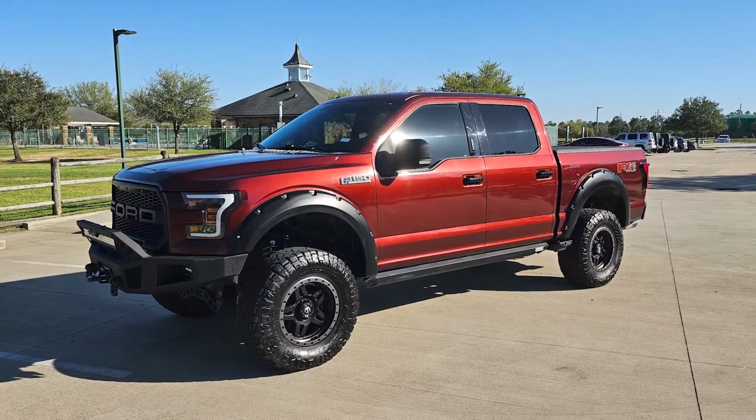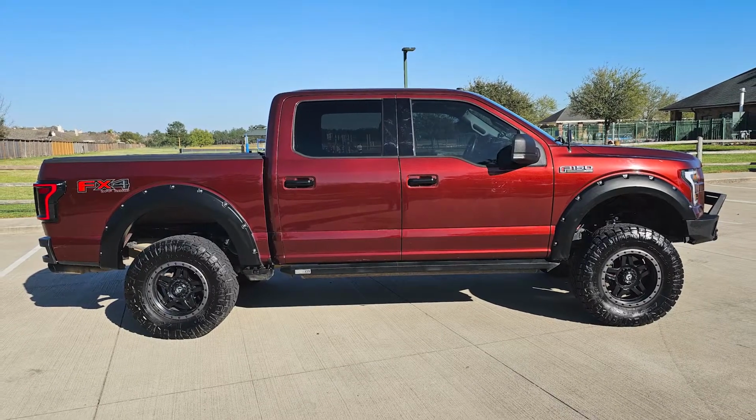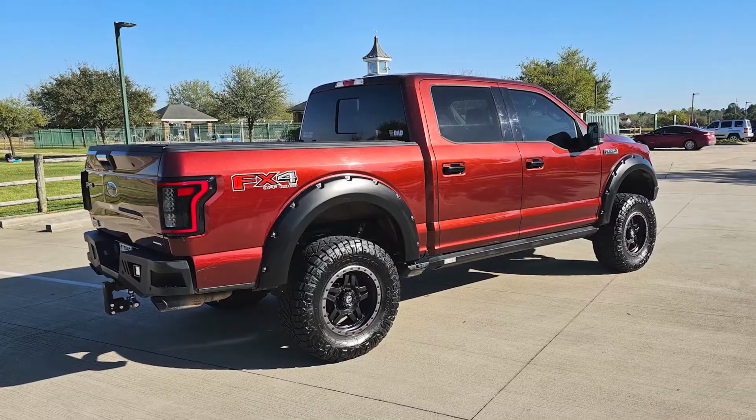Now, you obviously stepped up pretty big as far as size is concerned compared to OE. Did you recalibrate your truck, or did you tune your truck, accounting for the larger tires? I did, absolutely. I had a Bully Dog tuner, went in and changed the ratios, et cetera. So it's running with some GPS and doing some fine tuning there with the digital, and it works out perfect. My speedometer is absolutely perfect. But yeah, I would recommend to somebody, if they were going to go to a tire of this size, you get a fairly large discrepancy on your speedometer. So whether you do it yourself or you have a shop do it, I highly recommend you get that done.